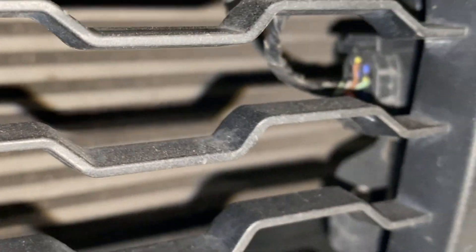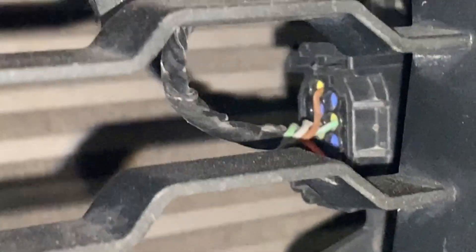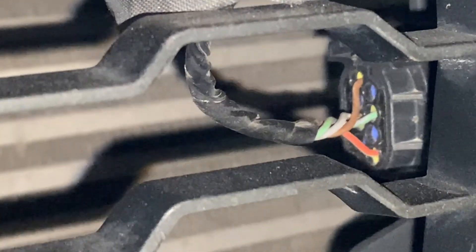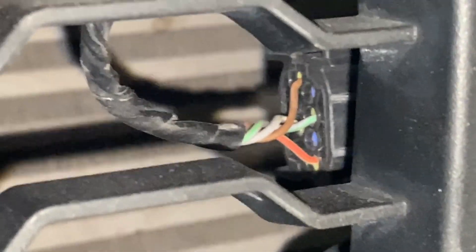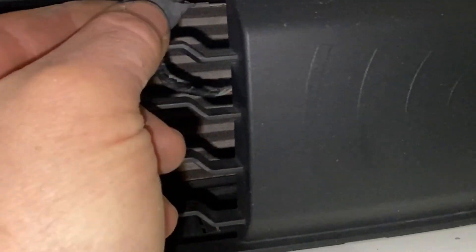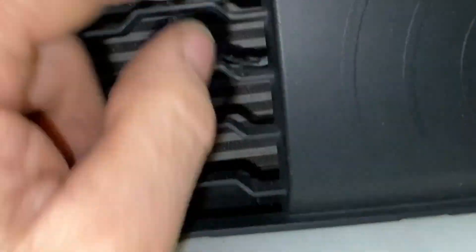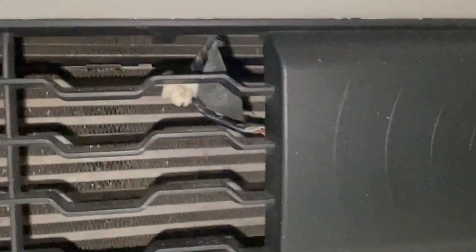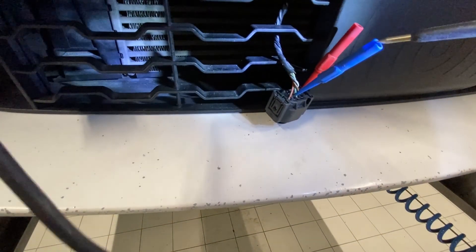I'm on the four-poster ramp today, which is an absolute nightmare. There's the ACC wiring — you can see the red and brown is the power supply, and the CAN is twisted. Looks alright, doesn't it? But there's always a clue in there. Look at that hanging down — obviously there's going to be a broken wire. We've got a power supply to it and it's still not communicating.